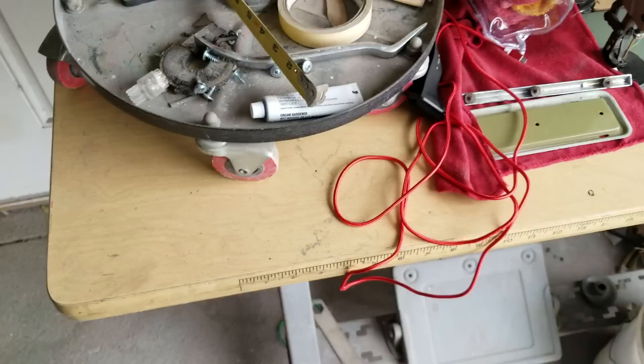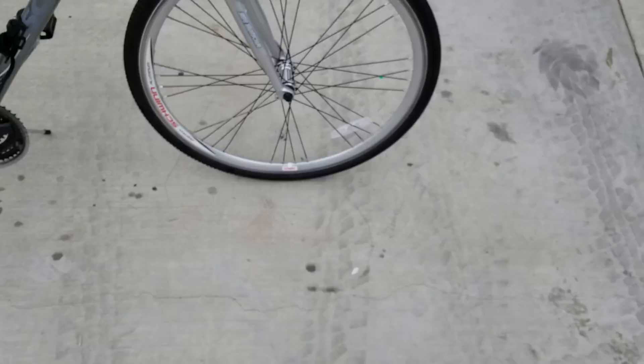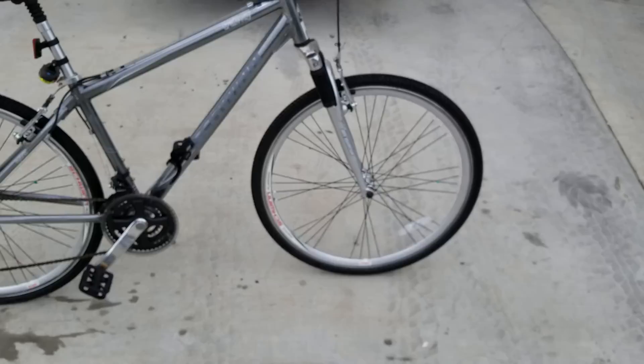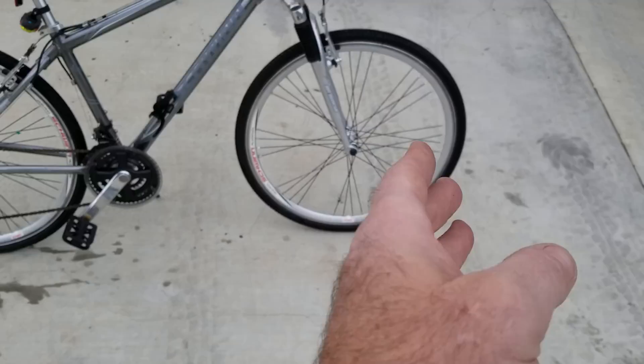Let's talk a little bit more about the positives and negatives. When you have a heavy vehicle and you have too much positive caster — let's say this nut was way out here on the axis — what happens is it becomes harder to steer. On heavy cars, they didn't want to put too much positive caster in because it would make steering really heavy. And if you had a heavy engine in the front, you didn't really need it as much because all that weight in the front would make the car go straight as an arrow, but it'd be really hard to turn in parking lots.